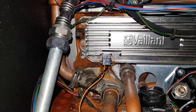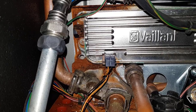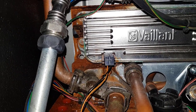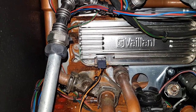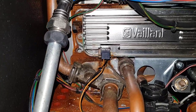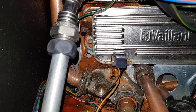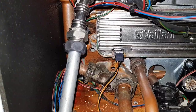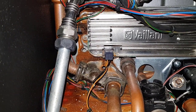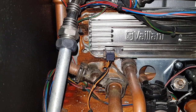So that F13 is basically this sensor here. The sensor on the plate heat exchanger is faulted because water was going straight onto it. So what we're going to do now is a resistance check on this thermistor — this sensor. We're going to check what it's supposed to be. At room temperature it should be around about 10 to 12 kohms.